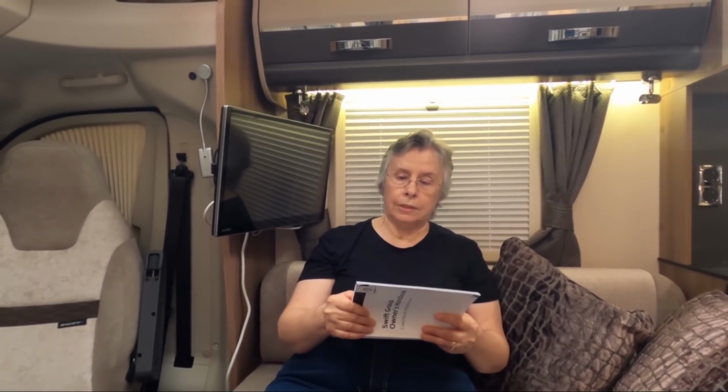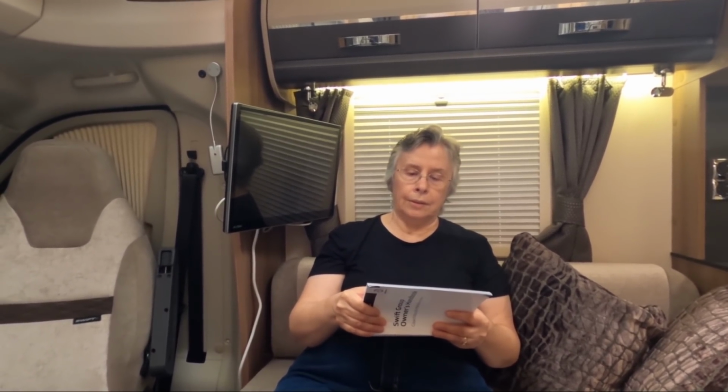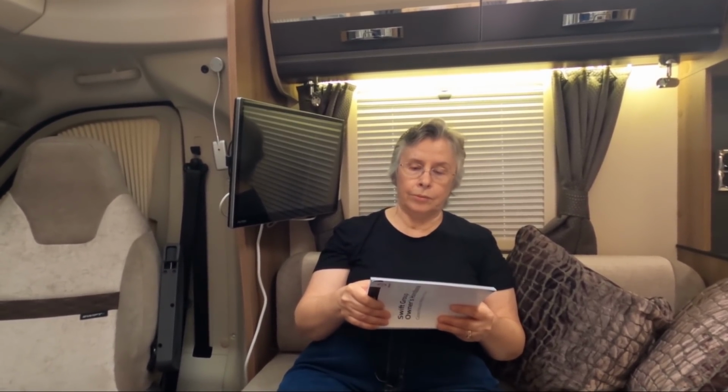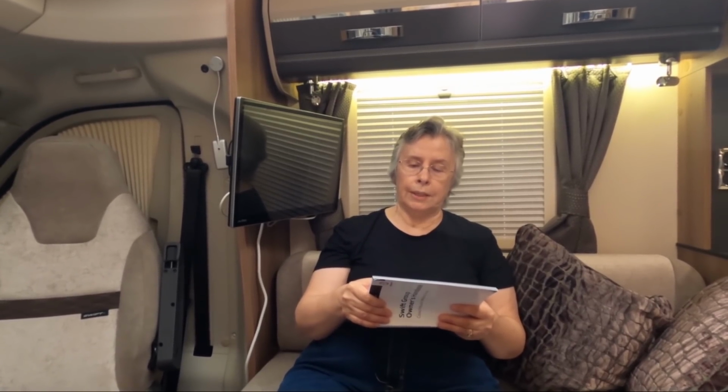Okay. So give me some figures on the 12 volt electrics. Well, the Truma heating takes 12 watts and 1 amp hour. Yeah. Okay. Then it's talking about the grill. Yeah. So it's 0 to 14.4 watts. Okay. 0 to 1.2 amps.